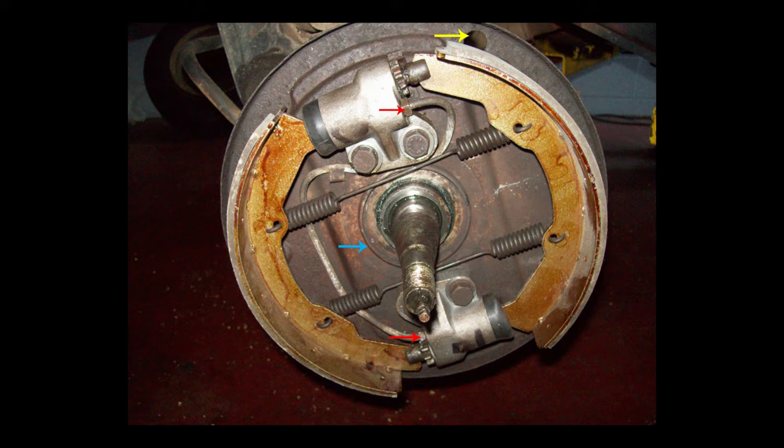The front and rear shoes on this — and by front and rear I mean on the front axle, the front shoe and the rear shoe — they're identical in size. But a lot of times, especially on American cars, you'll have a larger shoe lining at the rear and a smaller one at the front; not so in this case. I think you'll find it easier to remove these wheel cylinders with the connecting line still attached. Take it to your bench, put it in your vice, and then disconnect that line — it's hard to get to.